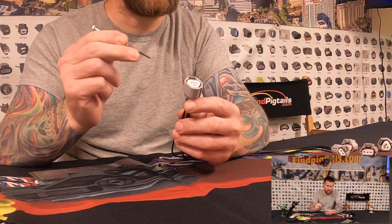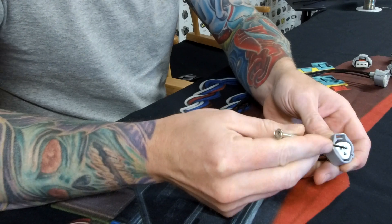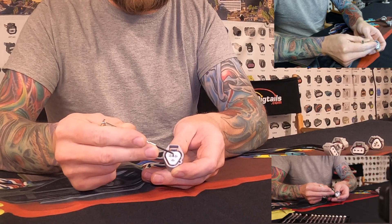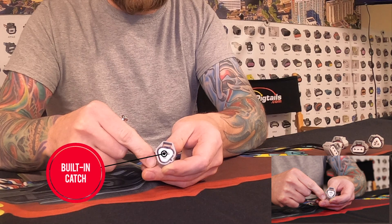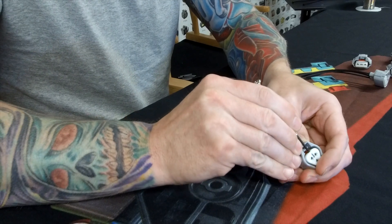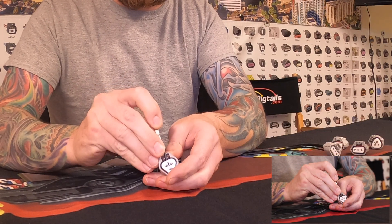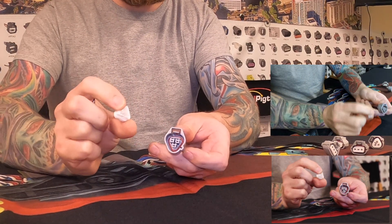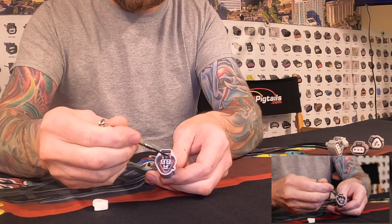Here's a close-up on the connector. On the face of the connector, you'll often see it's a different color than the outside plastic — this is the catch that goes in around the pin and pushes down on the built-in plastic catch of the connector. Put a finger in front so you don't send it flying, then pry just a little. This one has a perfect flat cut designed for a screwdriver — it releases and pops up, so remove it all the way. That's the secondary lock removed.